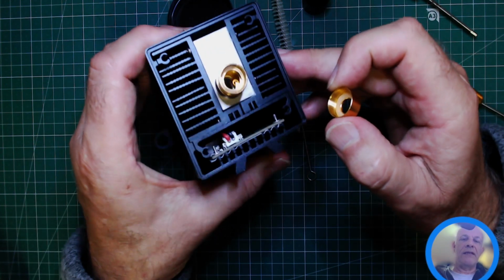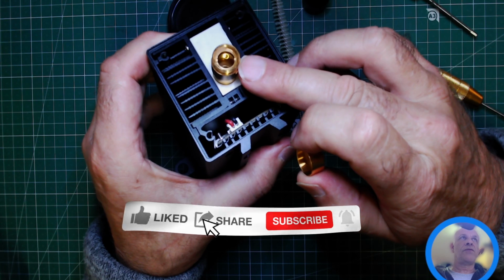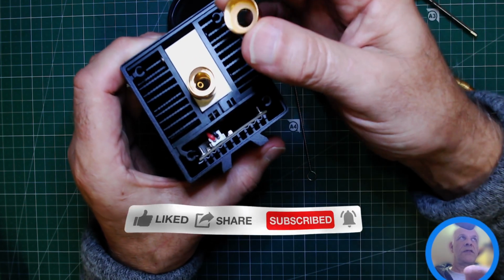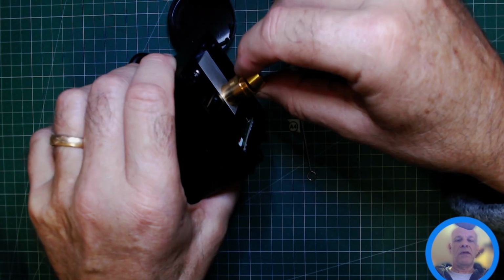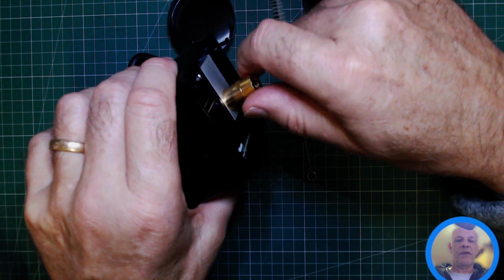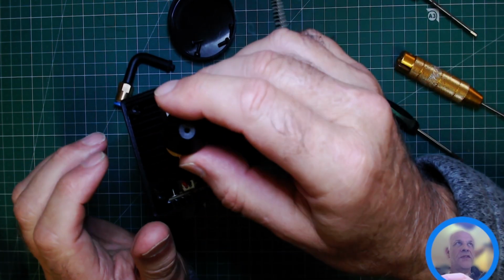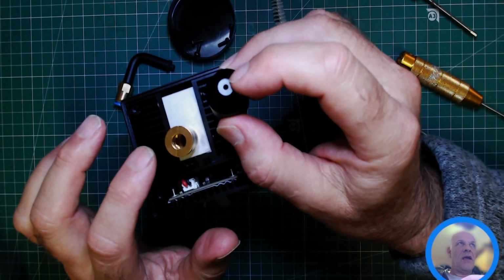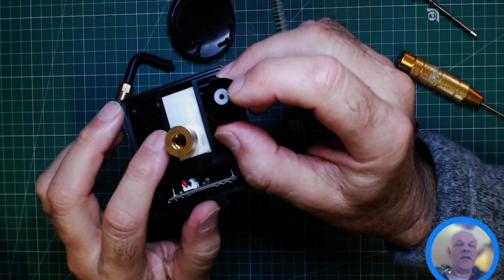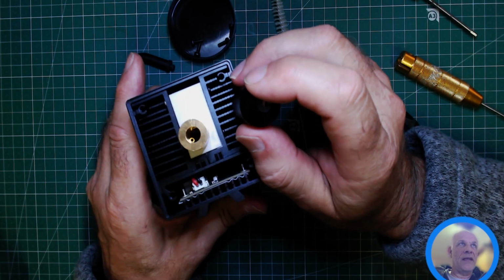I'll show you down the lens. The lens is about 3mm down. You can see the light just reflecting on that. So this is the job of the smoke guard, and you can buy new ones of these. Now the importance is that the job of the air assist nozzle is 2 things. It helps you obtain better cuts. It does help with engraving, but you need to reduce the pressure. And it stops, well, it tries to prevent, and it does a very good job.